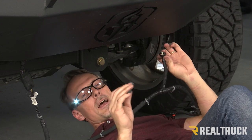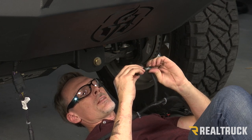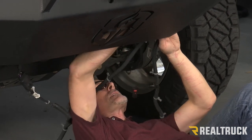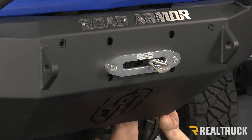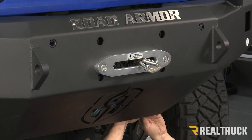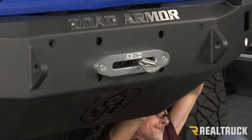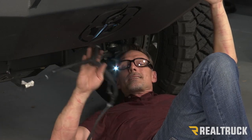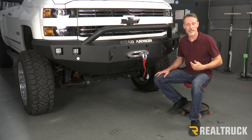If you have factory sensors, go ahead and run your wires. For the inside sensors, snap the sensors back into the harness, then raise that sensor up and snap it into the center bracket, making sure it's lined up the exact same way it came out. For the outside sensors, run those wires to the sensor location and fasten them in place. Once we've done that on both sides, we're going to tie our wire harness in place and secure it. That concludes the installation. If you have any questions, call the experts — we're here to help you out.